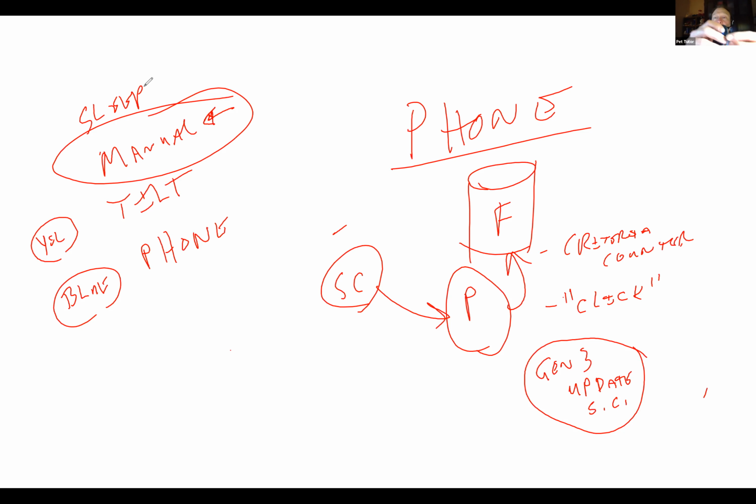And the only other mode is the phone mode, which is the blue light. Press and hold the rough button. Then the right hand smooth button is yellow, and now it's blue. If I release, now it's flashing blue, saying I'm ready to connect to a phone. If I change my mind and say, oh, I don't want to connect to a phone, press and hold the rough button and the right button again, and now it's stopped.